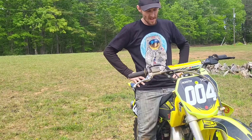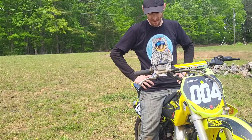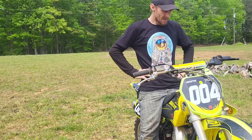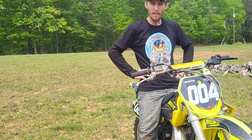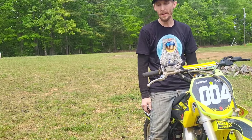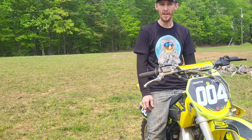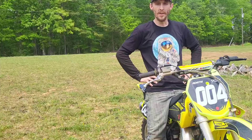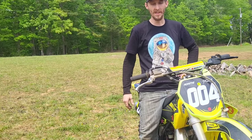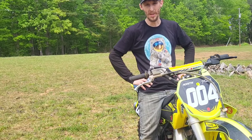All in all, I think it's a pretty fun little bike. I don't want to be too hard on it just yet — let this thing get good and broke in. I'd say after they've run it for a little bit, it's probably a good idea to check your coolant. I'll do that before it leaves, and after about two or three hours, I'd probably change the oil in it, just because it's got a new crank and bearings, and whenever you put new crank and bearings in, they're going to wear and you'll get wear particles in your oil.